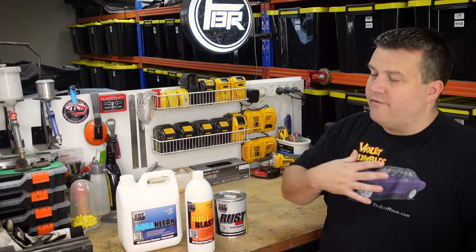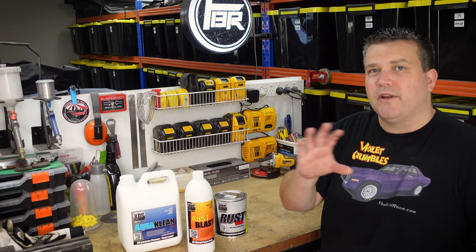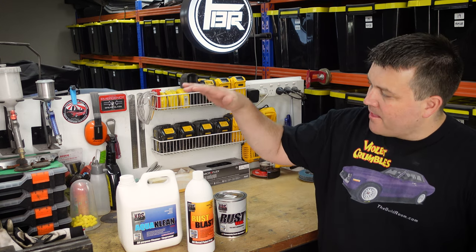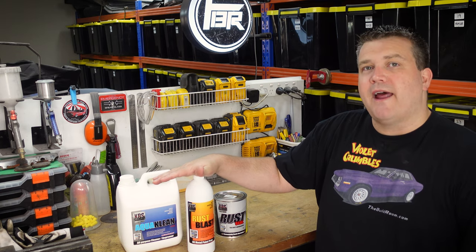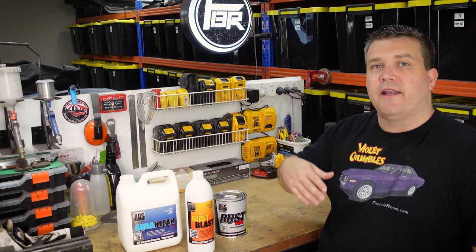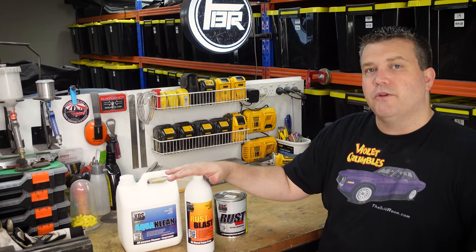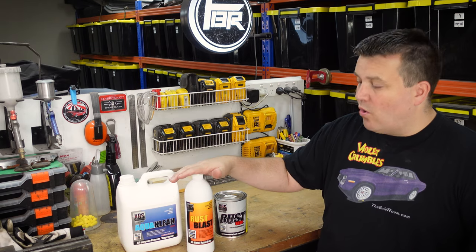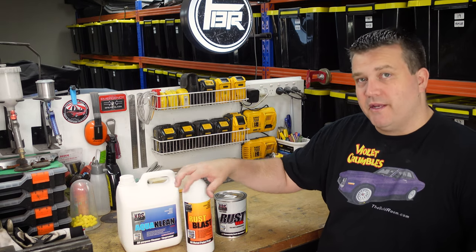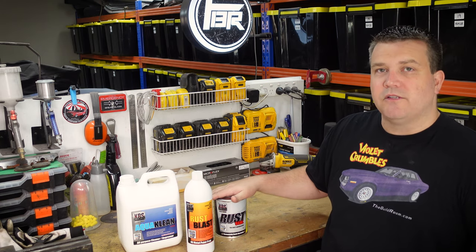And then mainly for me, this is around the pitted areas that still have some discoloration. They're not perfectly clean sheet metal. To liberally wet them down and keep them wet. So the idea is you keep coating on this and keep it wet and wet and wet. And then again, you wash this off using water. So I'm gonna make sure this gets into all of the nooks and crannies and all of those pitted surfaces. And then I'm gonna dry it as best I can. And then we'll get onto the rust seal.